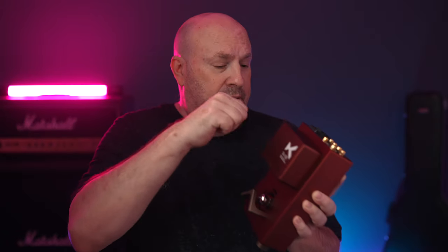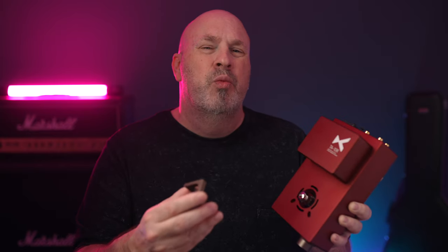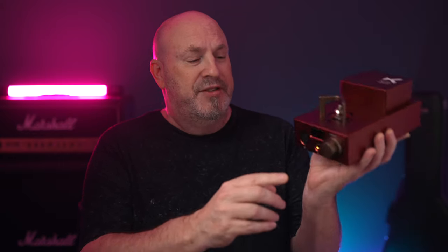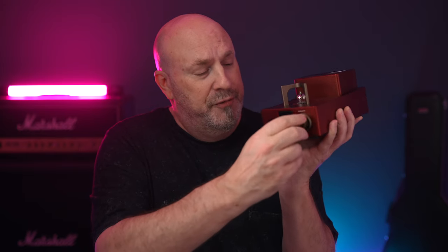For the price range, you get quite a lot here and it's very, very well made. It's built like a tank. This tube right here pulls out — you can also change it out. If you have some vintage old tube you'd really like to use, you can use it. But you don't want to use a really hot tube inside of here — don't use the hotter ones from guitar amps, it just won't have that good of sound. You want to use one that's a little lower powered so it isn't so brusque. It just pops right in. The controls are simple — you've got a push-in button that changes two different functions and a scroll knob. You've got your standard headphone jack, and if your headphones don't have the quarter-inch jack, it came in the box with an adapter.